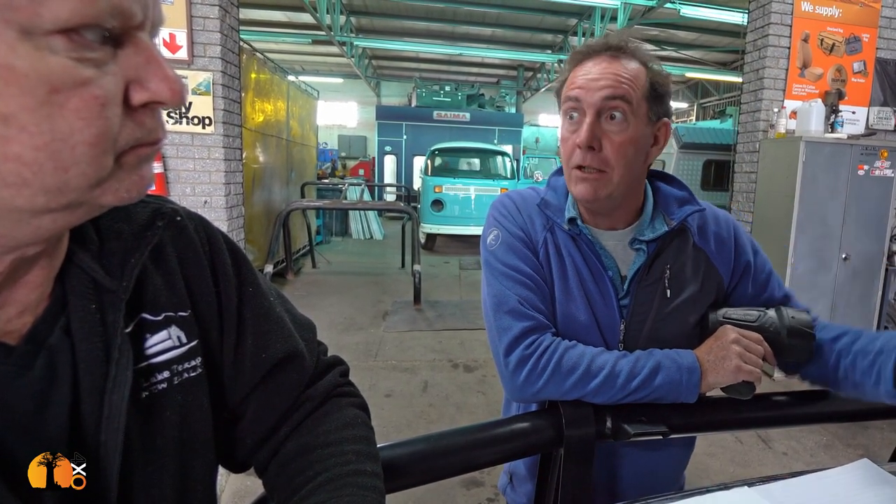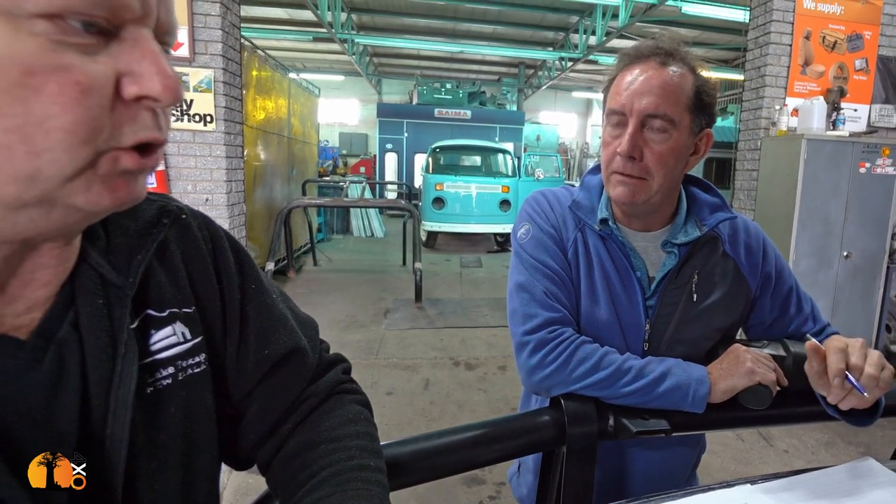By going through the car and looking for leaks and signs of wear on rubbers, certain amounts of those we know we're going to change. We're going to change suspension bushes, wheel bearings, and do the brakes. I'm less worried about those components. But I do need to know that when you brake she's not pulling violently to one side — it didn't pull. But there is a warped disc, because on light braking I can feel it. That's an easy thing to sort — it will be remedied when you change the brake parts.